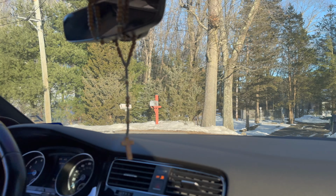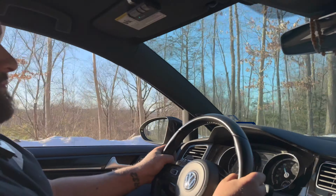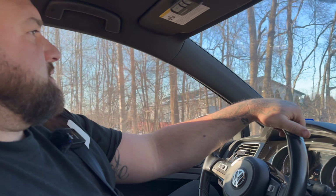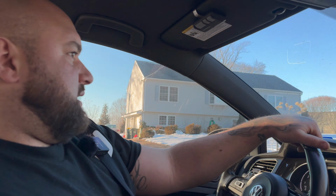Meanwhile. Nick? Yo. We are back in the Golf R. We're spinning all four, huh? Yeah, so it was on the dyno. We were doing pump gas numbers. On pump gas, it made 525 on 93 octane. Yep. We had to pull it off the dyno real quick to replace the high-pressure fuel pump and the water pump. The high-pressure fuel pump was a three-year-old unit.